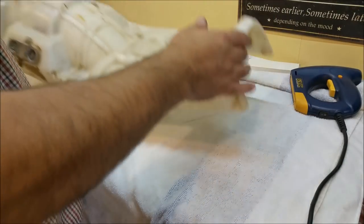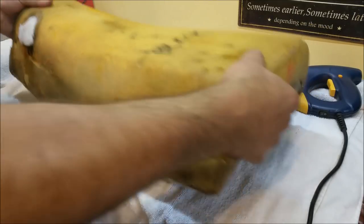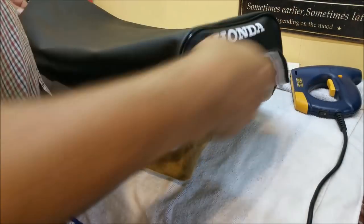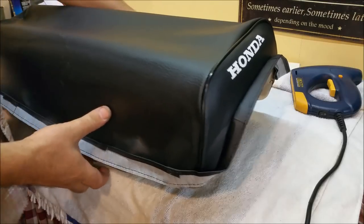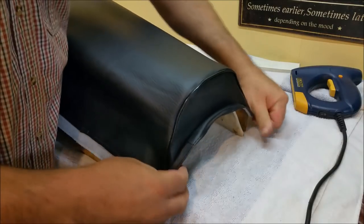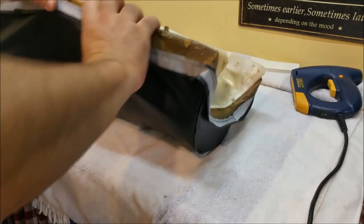I want to see if we've got the right cover. If I turn that around and get the seat padding — it sort of sits over like this. It's moulded on. I've got some Dacron to stuff around here and there to get it nice and smooth. The cover we're putting on is much nicer than the old one — it's got piping and it's got Honda written on it. I just want to see if it's the right one, and by all accounts it appears to be. I'm just going to turn it around so I can see what we're doing. We need to get the straight edge and stick it over, and that of course will tuck underneath. The thinking is it might be a bit too short, but once we pull the sides down and around it's going to end up fitting really well.